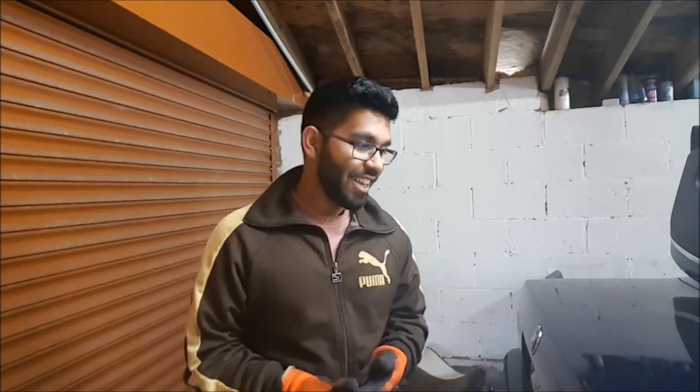Boom. Got those four bolts loose. I thought it's easier if I break them loose while the car still got pressure and weight and everything. Now I'm just gonna jack the car up, get it raised up so I can undo the last bolt at the bottom. And then basically, jack the car up, move the wheels, put it on axle stands, and move the last bolt. That's it. It's so simple to do the rears. So yeah, just gonna get those done now.